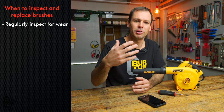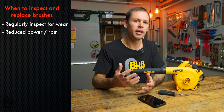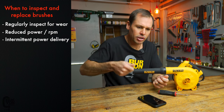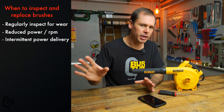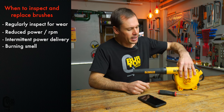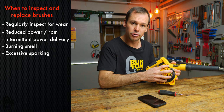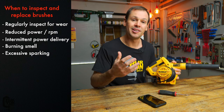There are a couple of other telltale signs — and this applies not just to blowers but to drills or anything with brushes. If your tool is a little low on power or not reaching the full RPM you're used to, that might be a sign. There could also be intermittent power delivery — you pull the trigger, it's not working, you pump the tool around and the motor powers up and down. There could be other problems, but very worn brushes could be the cause. A burning smell is also a telltale sign, as well as excessive sparking — you can sometimes see this through the air vents.